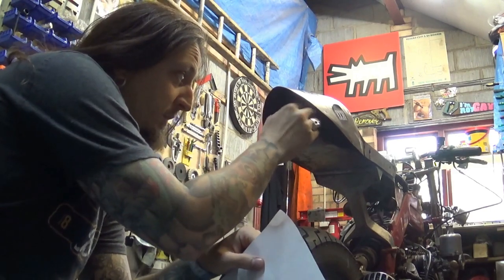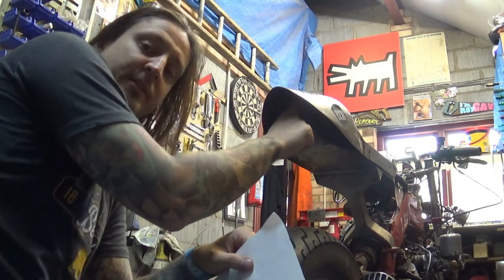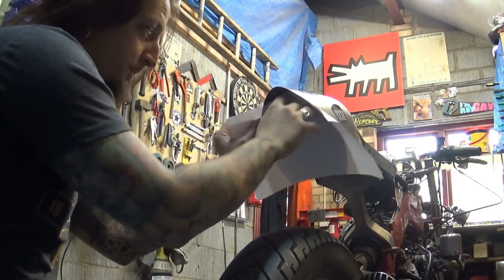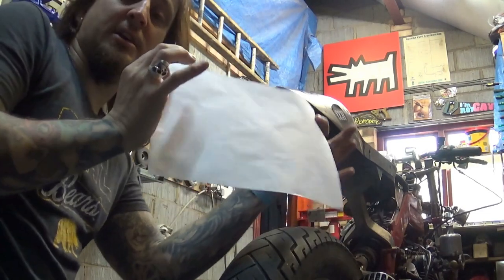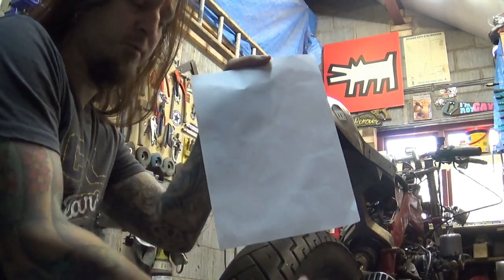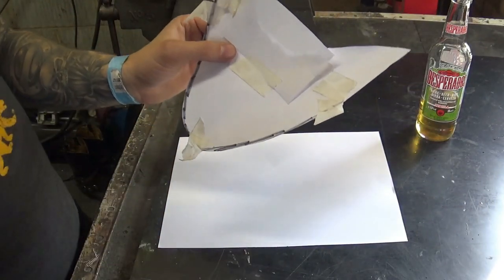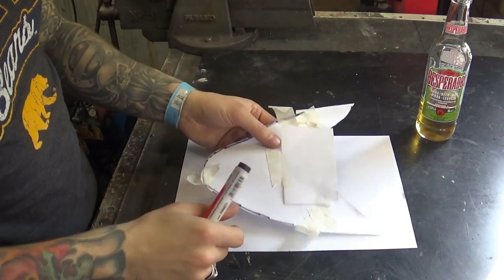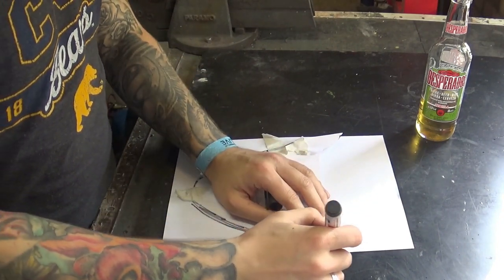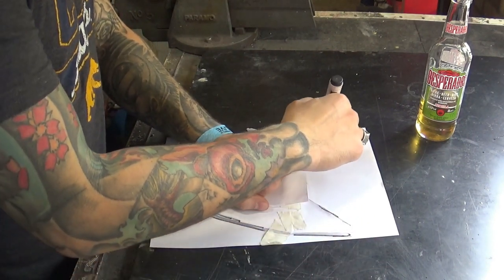The first job is a little splash guard underneath the tail section — the cafe racer hump — to protect all the electrics underneath the tray. So when the tire flings water, it gets stopped by that little splash guard. I like to start all fabrication with a piece of paper or cardboard — whatever works for you. Basically you can make the template from a single sheet of paper, then transfer it to steel. After some time I came up with a shape — a bit ugly — but I'm going to make it from one piece. That shape seems to best reflect what's happening underneath the tail section.